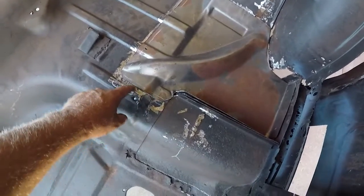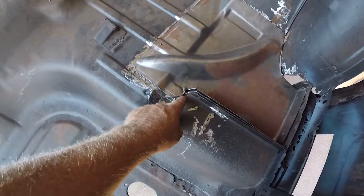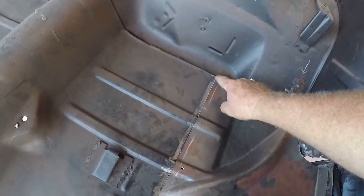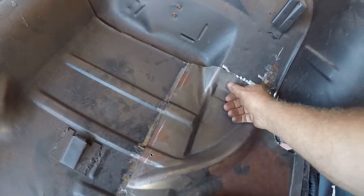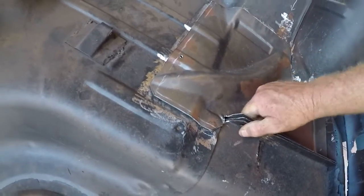What we've done now is ground away the surface here to weld to, cut the corners back here and here, cut the corner again, up the back here. This was overhanging, so we've cut that. Then it'll go back in. Cut this lip down because this was sticking up, and then put the snap grips on there.